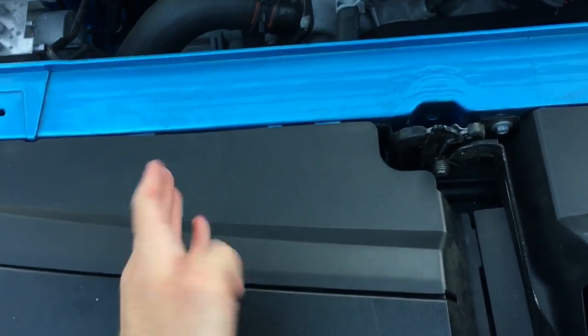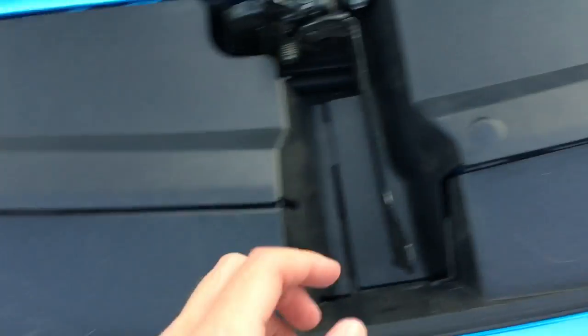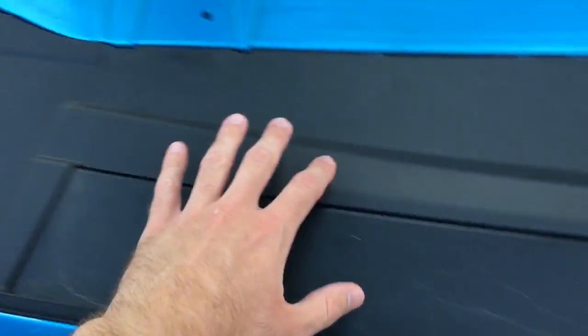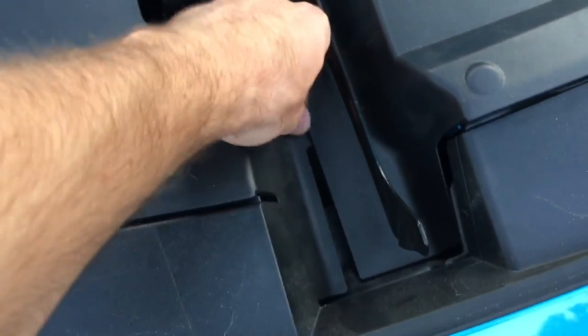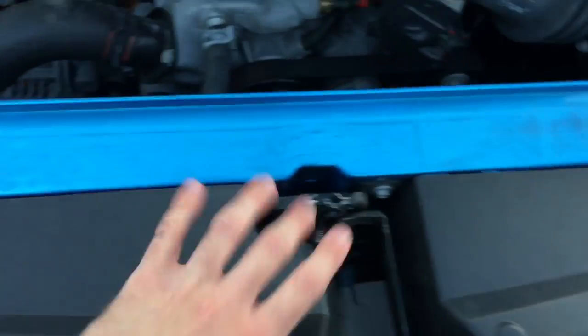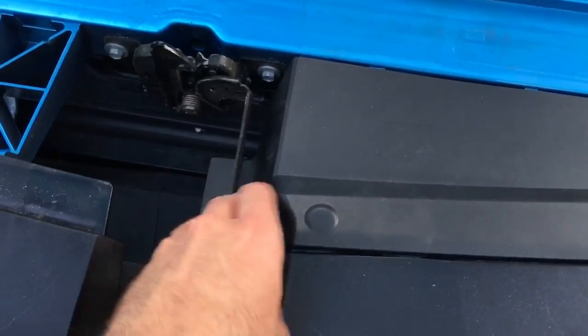Okay, so basically this is going to be really easy to do because the horns are located right underneath the front of this plastic here. All you do is lift these out — they're literally held in by a couple of clips. There's like one here, there, and there, and then these two little tabs that go into the side, same on the other side. And basically all you do is pull this out like that. And boom, there's the first horn. This kind of just comes out without too much hassle — I can pretty much do it one-handed. Side pull this part, there we go.